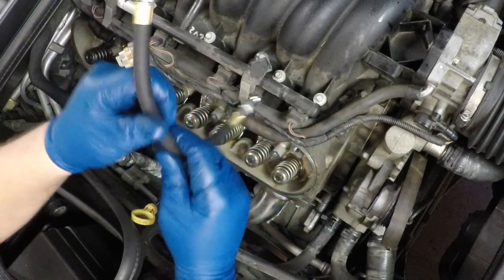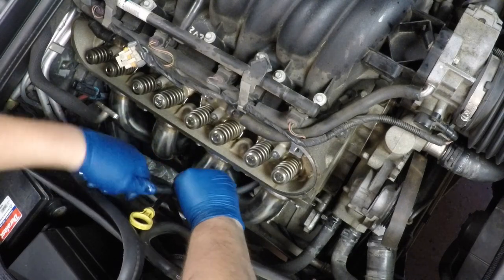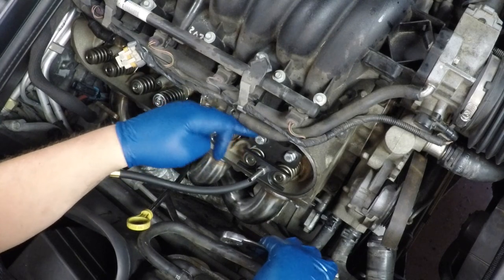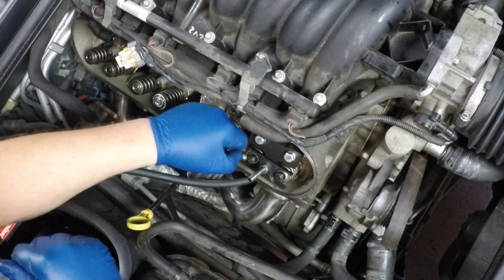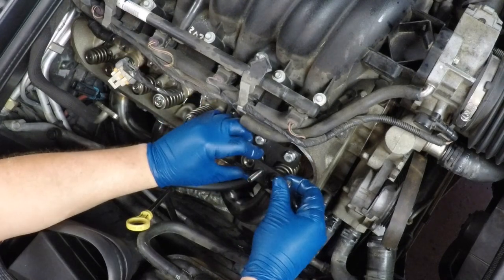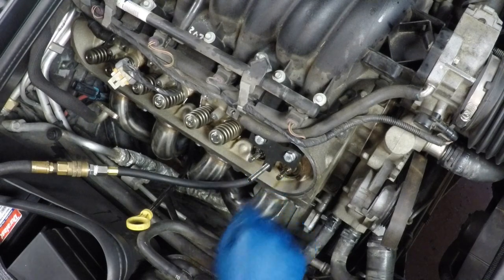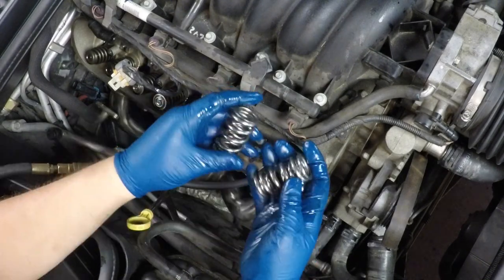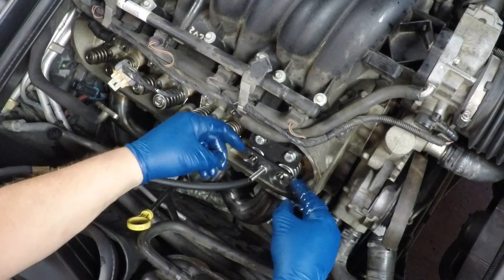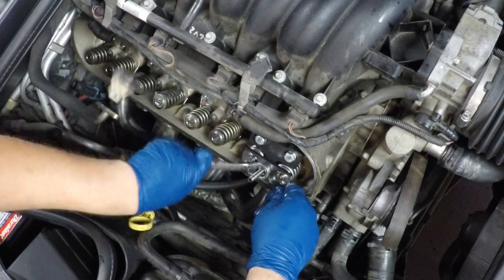With all the spark plugs removed, we're going to take this pneumatic valve holder — it threads into the spark plug hole and then you put compressed air to it, which fills the combustion chamber and holds the valves up so they don't drop in. With compressed air in the cylinder, we have our valve spring compressor tool set up — it bolts in right where the rockers bolt up, and we tighten it until the springs are compressed enough to expose the keepers. I grab the keepers out with a magnet, remove the old springs, and also remove the old valve seals since we've got new ones. We get the new valve seals pressed on, then install the new dual valve springs with the new titanium retainers, and compress them back down to seat the keepers.